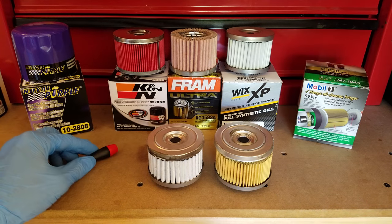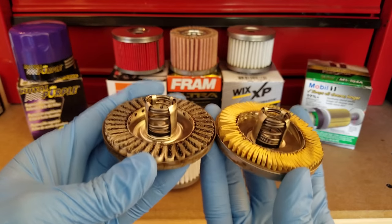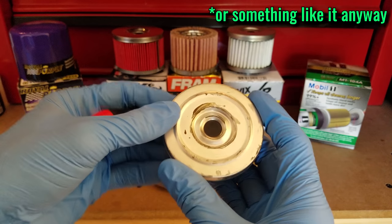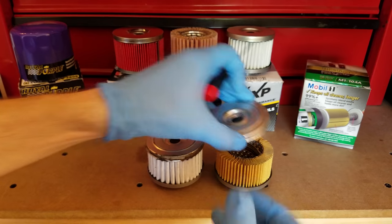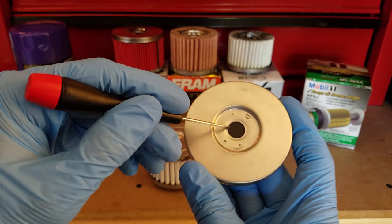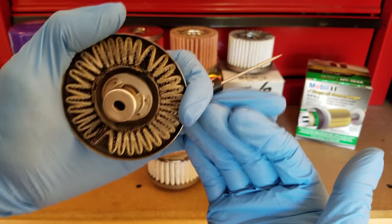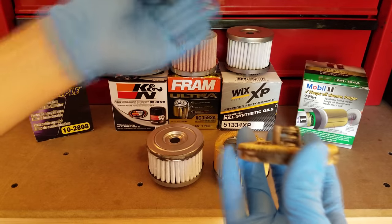The first thing I want to cover in detail is the emergency bypass valve design, which I'm really impressed with. The first reason I like it is that the seal is made out of rubber — a soft material that will conform to the mating piece and close up any gaps. In contrast, on this Wix XP here, the seal is made from a hard material, possibly hard plastic. When you have two rigid pieces trying to mate together, nothing is really apt to give to close up any gaps, so I feel more comfortable that the rubber provides a better seal.